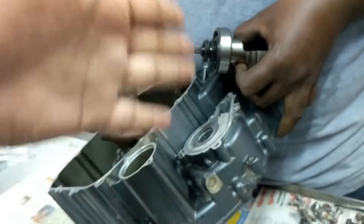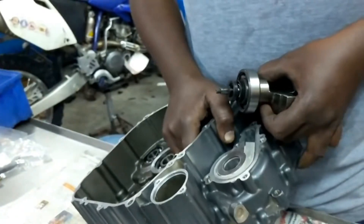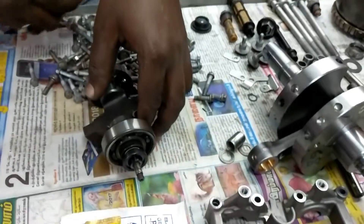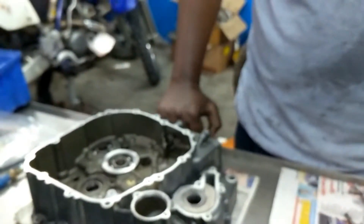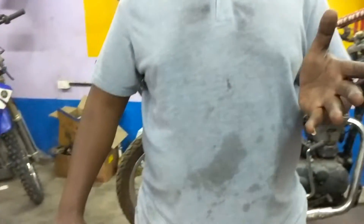There's always a backup plan, so that in case these seals fail, no harm is done to the engine. KTM — or should I say Bajaj's engineers — should have really considered making a plan B, because we've seen a lot of KTM Duke 390s having this issue. Within a small ride or one month, the coolant in the reserve tank will be empty, and owners are left searching where the coolant went — it went into the engine oil.